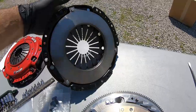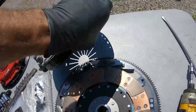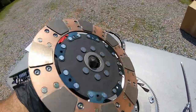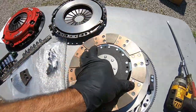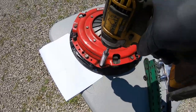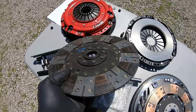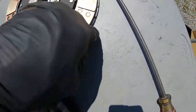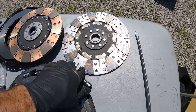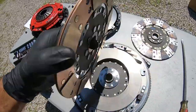I'll pull this top plate off — looks pretty good. There's the first ceramic disc. Looks a little small compared to the McLeod — I wonder if it's going to be able to hold. Let's take the McLeod apart real quick. The McLeod has two washers. This is the top plate of the McLeod — my other McLeod is used, this is just my spare one for both of my turbo stick-shift cars. They're always labeled appropriately — top and bottom. The Competition Clutch is just slightly smaller than the McLeod one. The McLeod has nine ceramic pucks; this one has eight.